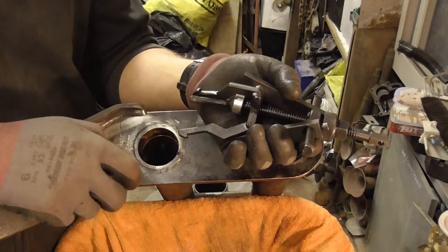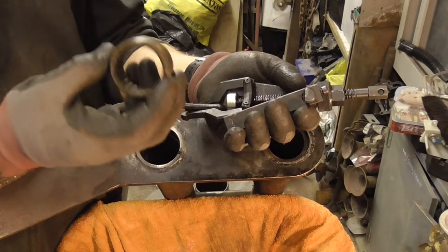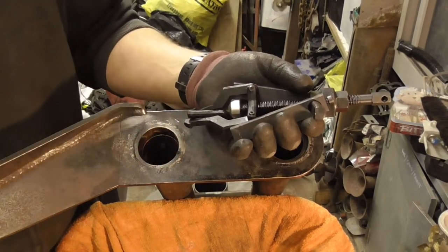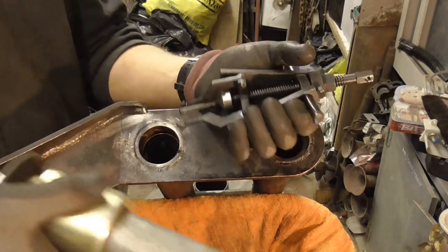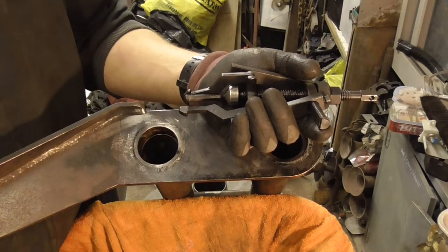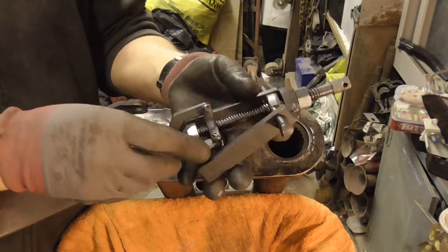I'm just in the middle of doing a beam build video for the Lanchester Rat Rod project, and I was having a real fight getting the needle bearings out the end. I tried using a jimmy bar to pry them out. I even tried making my own slide hammer to knock them out from behind, but they weren't budging. So in the end I went on eBay and bought a cheap pin bearing puller.